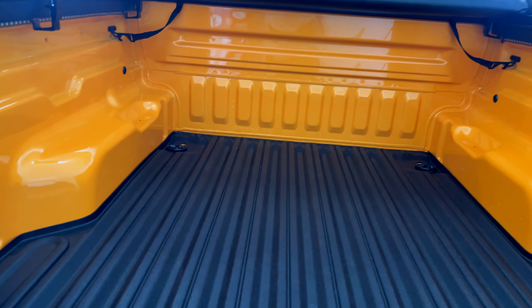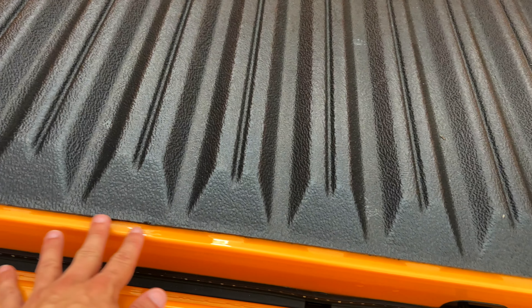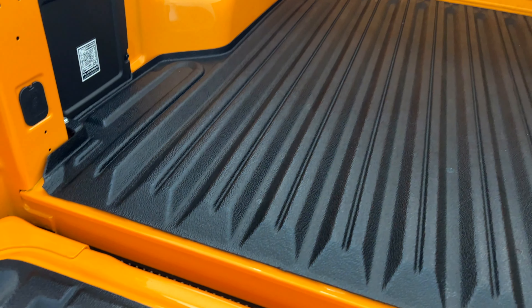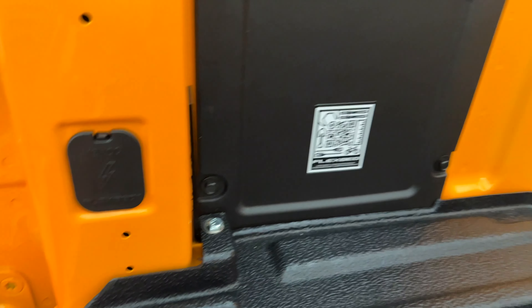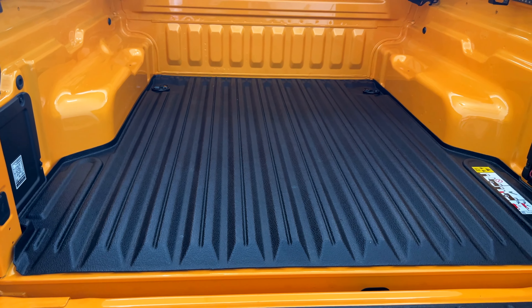We finished installing and putting back the screws. What I did is push the bed liner as far back as I can so it covers this area much better and not as much at the very back. Moving it all the way back also means the L bracket works better — it'll be tighter on both sides. The next step is tightening those screws so it's locked in place.